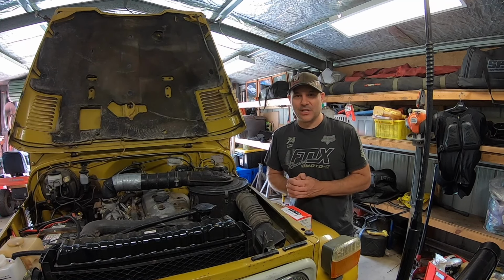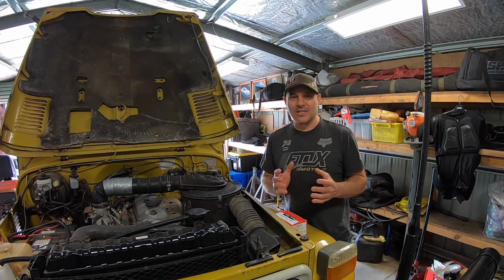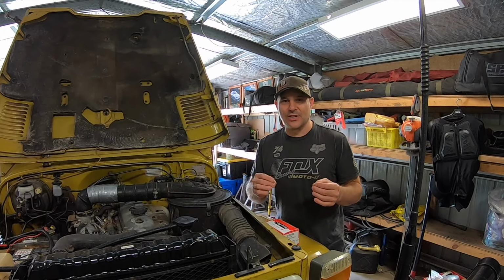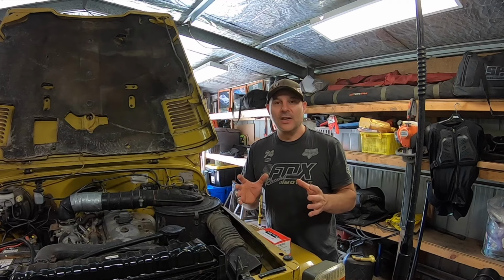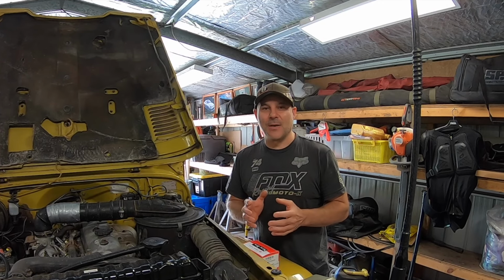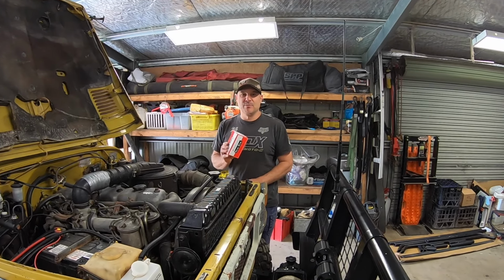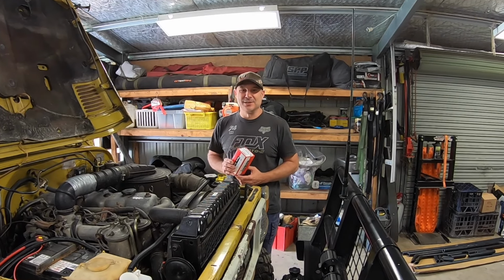After speaking to my auto electrician friend, he also asked me if the headlights are brighter than normal. And I said yes, sometimes the headlights become very, very bright and it's the same amount of time that the radio turns off. There is also a filter for the fuel that turns on, and when it turns on the headlights are bright, the radio turns off, but also that fuel filter warning light doubles up as an alternator or charging problem. So my friend advised me it's more likely to be this voltage regulator that needs to be replaced. So we're going to put this new voltage regulator in and we'll see together if that is the problem.